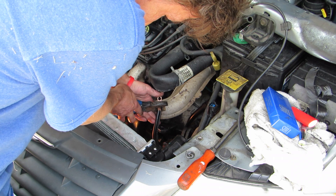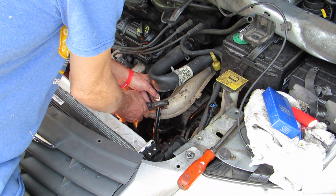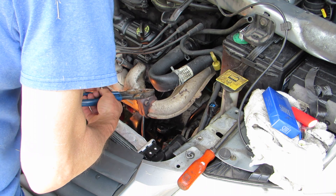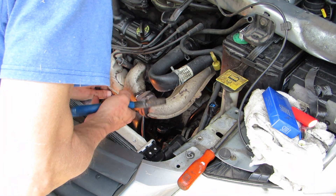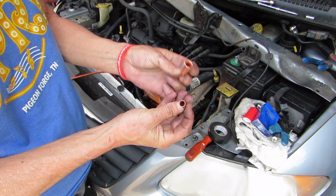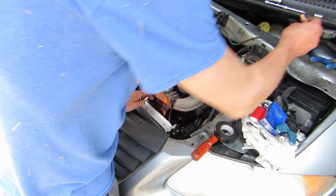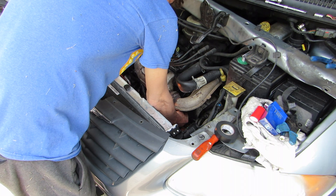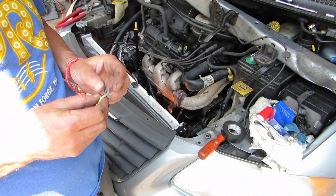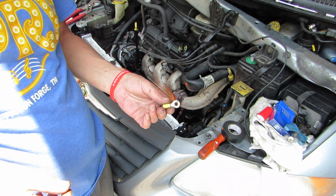The first thing I had to do is cut off both ends of the wires — both of them were burnt. Then I had to strip both wires to allow enough room into the connector and be able to crimp it nice and tight, tape it up with electrical tape, and bolt them back onto the stud individually. The battery cable that was on there was too small and was made for a lawnmower, so I had one in my shed that was actually made for a car and would fit perfectly — I just had to crimp it and tape it up real good. Then I got another connector for the smaller wire, I think it's 10-gauge wire. On the smaller connector, the hole was not big enough to go around the stud, so I had to ream the hole out with a rattail file on a drill.